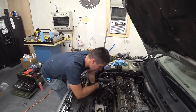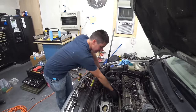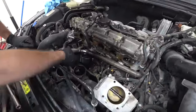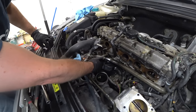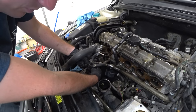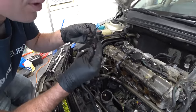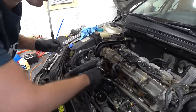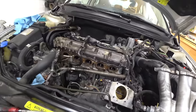That took a long time. Now we've got it apart — we can swap out the PCV. You can finally see the PCV canister. We're going to make sure the banjo bolt and everything is clear of carbon. Pull this guy out — there are copper crush washers on it, so we're going to be careful not to drop them. One's on the banjo bolt, one's on there. We'll clean that up with some brake clean and clean out this line. There are two pins holding on the canister, so we're going to start pulling it off.